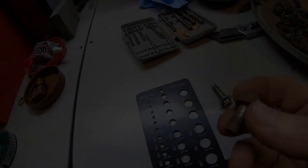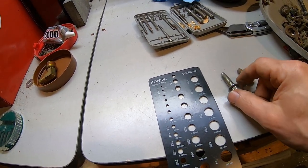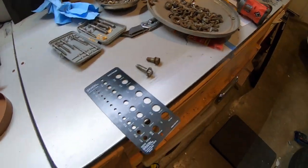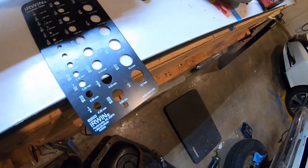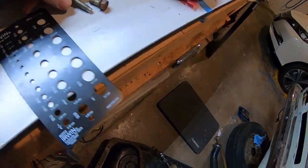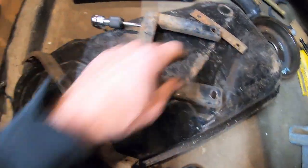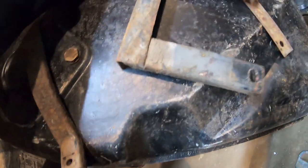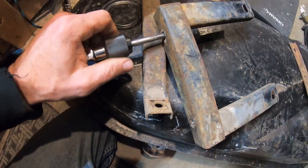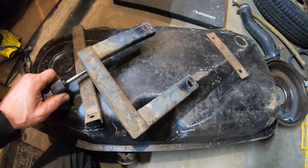Alright, so the gas tank bolts look like they're 5/16 by 24 pitch. So they're standard. Missing them, so I noticed that 8mm is pretty much basically the same size. 8mm by 1.25. The tap just goes right in. Just re-tap the two on the tank and the two on this bracket. So these are all 8mm. So that was pretty easy. This tank is in amazing condition.